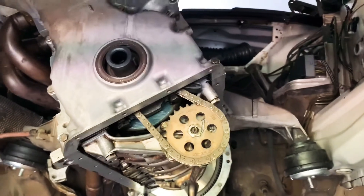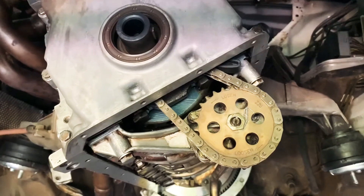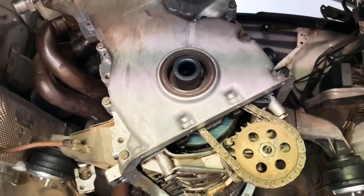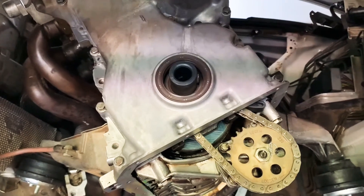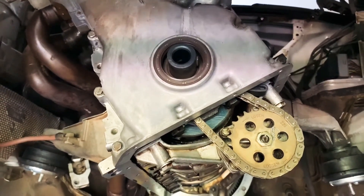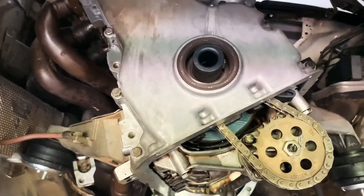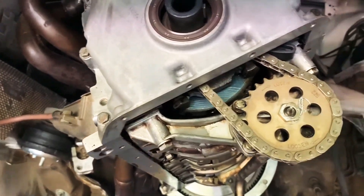The second thing — also not on the car at the moment, it'll come on with the new M3 oil housing — is the serpentine belt tensioner. In the case of the M3s and some six-cylinder cars they get hydraulic ones; other cars get spring-loaded ones. The purpose of the hydraulic tensioner is that it provides damping as well as tensioning. I've also replaced the hydraulic element in that to make sure we've got a properly damped serpentine belt.